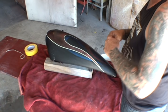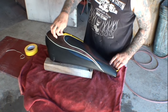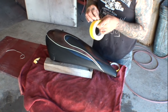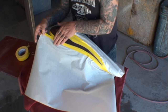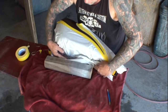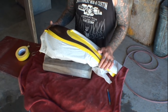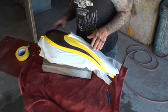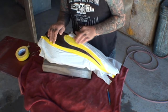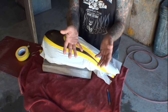So once we got the fine line tape on it, we can go ahead and tape it off with our three-quarter-inch tape. Look what I'm doing here — I'm going on the wrong side. We're actually wanting to go on this side of it, so I'll take my two-inch tape. When we paint this, we're going to have to use our touch-up gun and roll that under there so we don't get any overspray. I'm being very careful to show you how to do this. I shouldn't have the tank tilted like this because it can tip over and fall — but bear with me, I'm doing it like this on purpose to show you, the viewer, how to fix these kinds of mistakes.